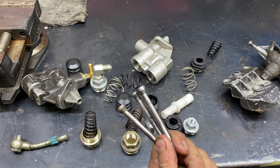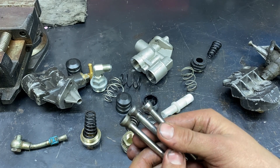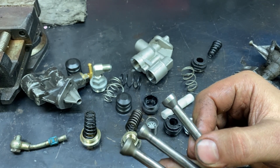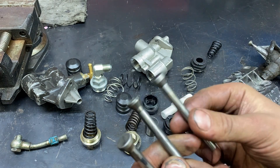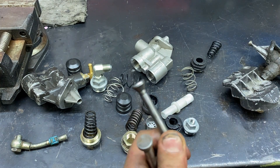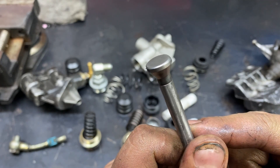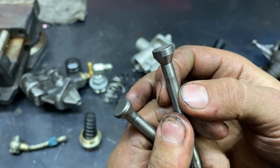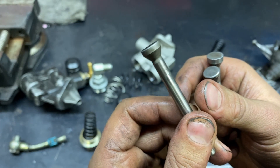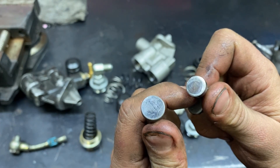It is possible that the cam lobe on the camshaft can get worn out, or these push rod kind of things can wear out. The cheaper Chinese ones will be more prone to wearing down through bad casting quality. You can see the one in the center here — it appears to have some oddball wearing going on. It must have not been riding right or they just cheaped out on the machining process. The Carter one looks nice and even, nice and thick. Another one looks pretty good as well.